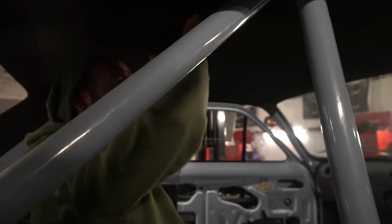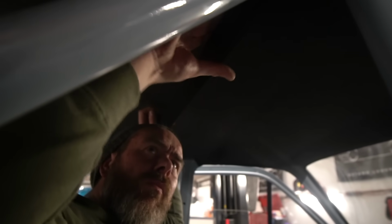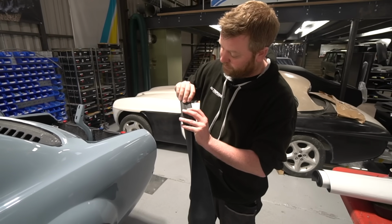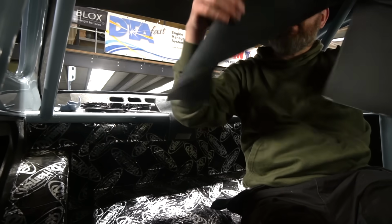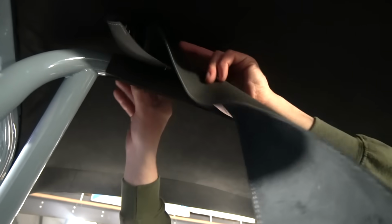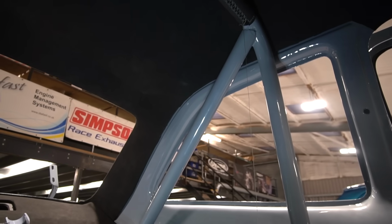And then Dean's just in the process of doing the cage. What we've basically got is these flat strips that have been stitched each side, and then they'll be wrapped around and hand stitched, much like you do a steering wheel, between the stitch loops on each side in a zigzag pattern. As I've mentioned previously, we were looking at the jeopardy of trying to upholster around the curves, which looked like it would be impossible without getting some really bad puckering on the inner part of the curve. So we're 3D printing corner finishes, which will be upholstered separately and applied afterwards.